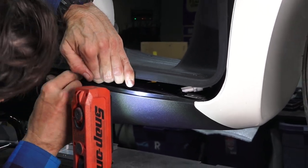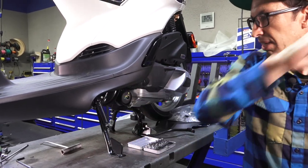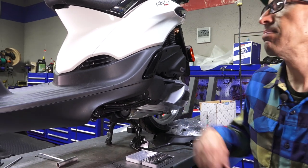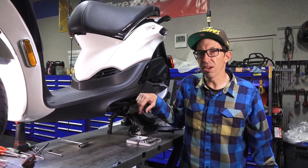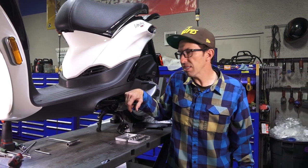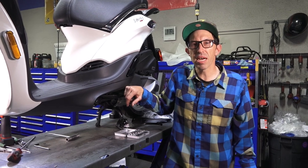Now we can close up the floorboard, get the pieces all lined up again, put the screws back in and we're pretty much done. Just to prove the side stand works — we'll start the scooter with the side stand up. You can see it starts up. Kick the side stand down and it stops the motor, then you can put it right down on the side stand. With the stand down it won't allow you to crank over the scooter. Thanks for watching — that covers all the steps and shortcuts for installing the original Piaggio side stand kit on the Liberty 50 or Liberty 150, models 2017 to current. Available at ScooterWest.com as part number LT10 — a complete kit with side stand and safety switch. This is Robot from Vespa Motorsport and ScooterWest.com, until next time.